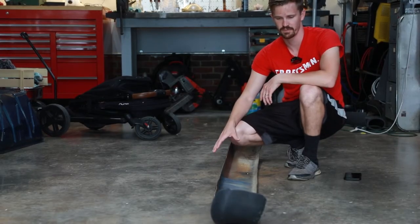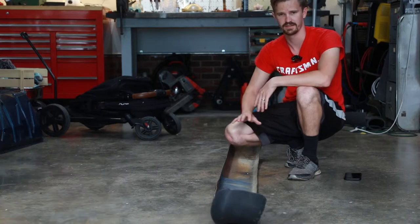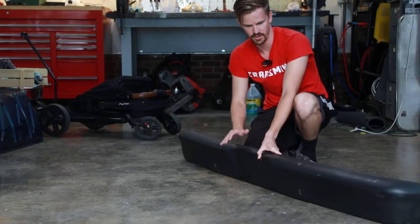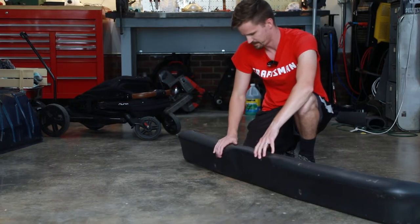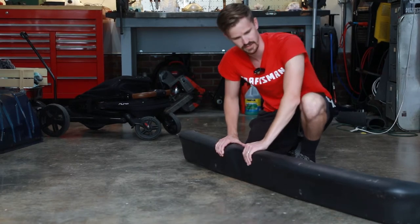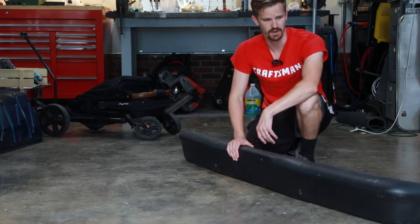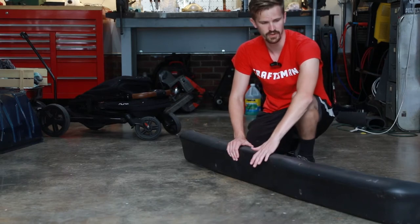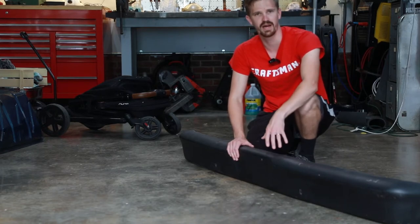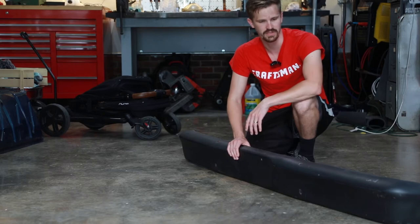The first step on getting the whole front end back together is getting everything repainted. I've got most of the parts already painted — I did the hinge, the latch and things like that. Went ahead and sandblasted those since they fit in the sandblasting cabinet, but for the bumper itself I'm going to have to use a different technique. The previous owner had just spray painted the bumper and grill black and that looks awful. I'd much rather go to white, and I'm pretty sure underneath this it is white. I think it'll look awful if I just spray paint it white — it'll be too new and it won't match the truck. So first we're going to try rubbing it with acetone and see if I can get this old paint to lift off. If that doesn't work, we'll sand it back and completely repaint it. We're going to try different techniques to make it look patinaed and correct. So grab some acetone and get to work.